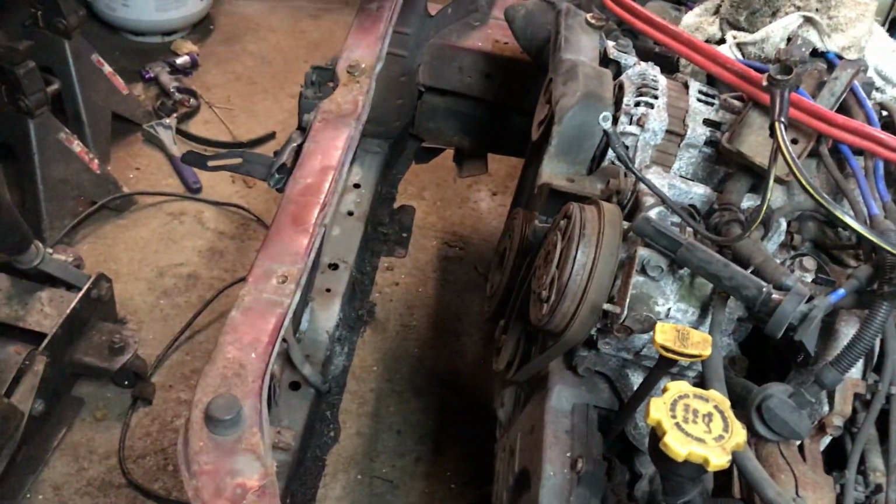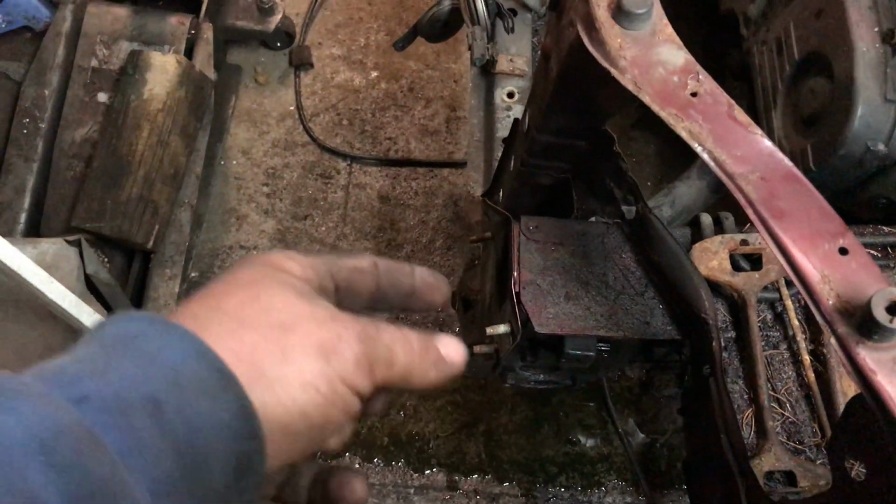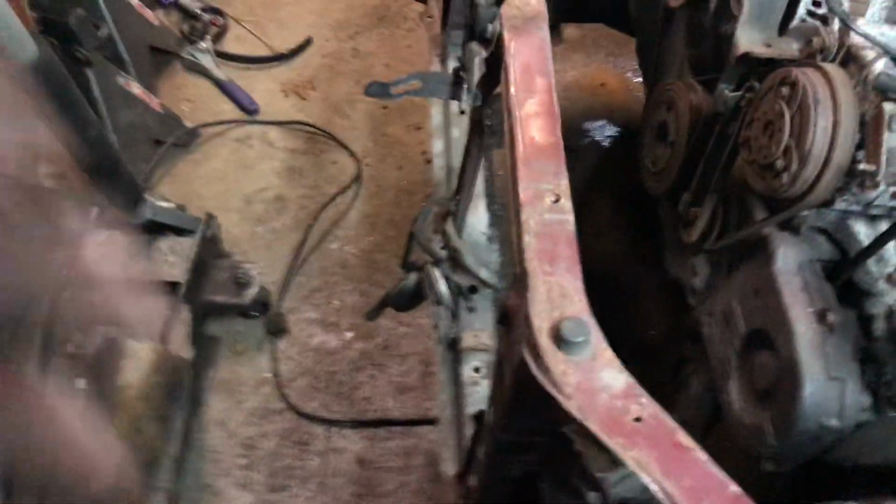And the bumper on this, I think I'm going to use a front bumper off a 70s Grand Marquis, or a 70s Ford bumper. It isn't anything special, it's rusty on the back. It came off that one car on that channel. It was a 70s Marquis on the channel. I kept the bumper and it was pretty rusty, but it's still solid, and we ended up cutting the ends off, so we shortened it a little bit for another car. I think what I'm going to do is put a shock in there, weld the shock, and then weld the bumper to the shock. That way I know it'll hold, and then it's got a good bumper up front.